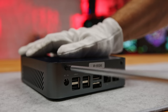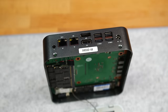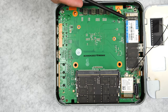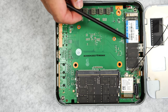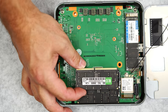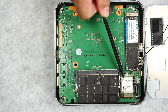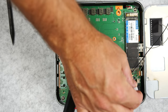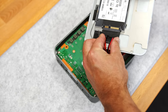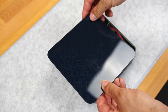On the back of the system we also find two screws that, by removing, allow us to remove the top cover and access the pre-installed 512-gigabyte Gen 3 M.2 NVMe SSD, 32 gigabytes of DDR4-2666 SODIMM memory, and the Intel Wi-Fi 6 Bluetooth 5.2 module. There's also a SATA connection that allows us to install a standard 2.5-inch SSD, which mounts to the underside of the cover plate.